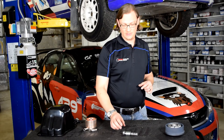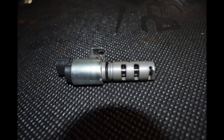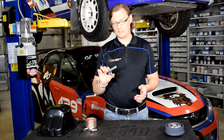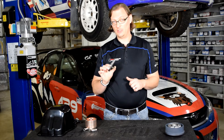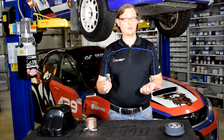Another thing that often goes overlooked is this — these are your AVCS solenoids. If you have a newer turbo car or a 2.5-liter turbo car, you have these solenoids that change the cam phasing. Oil flows through the heads and goes into these solenoids, and these are somewhat difficult to clean out. So again, if you're not 100% sure that you can clean these, they would need to be replaced.